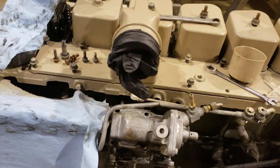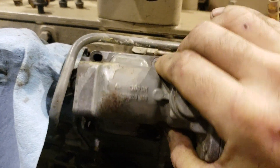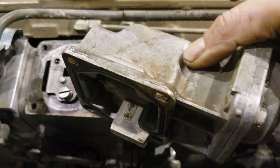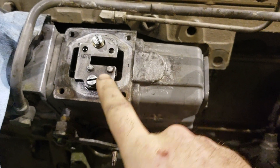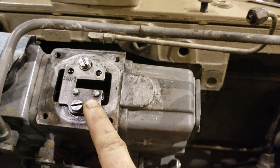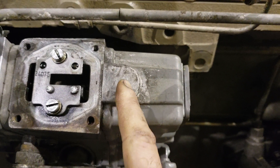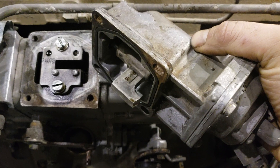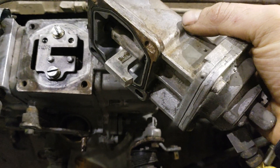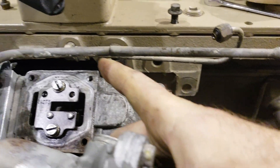If you take this off, you have a foot and a plate. There's your foot, and this is your fuel plate. You can replace these with different plates that have a different angle cut on it — you can't see it down in there — that a fuel lever inside rides on, and this works in conjunction with that. So as the boost increases, it moves this foot right here.